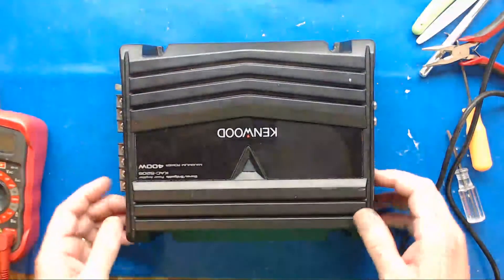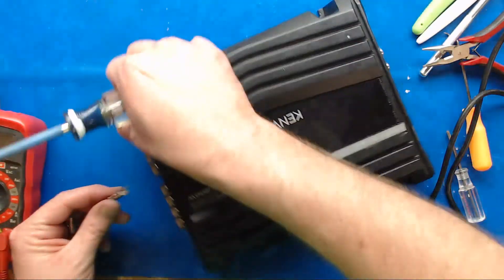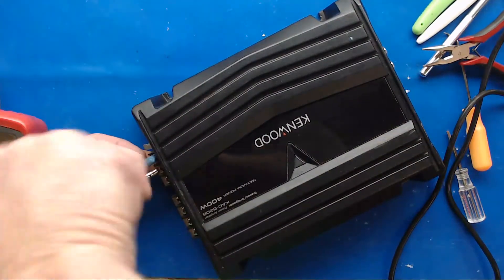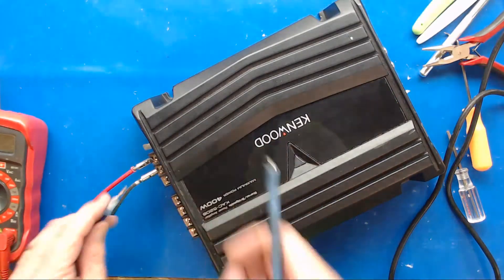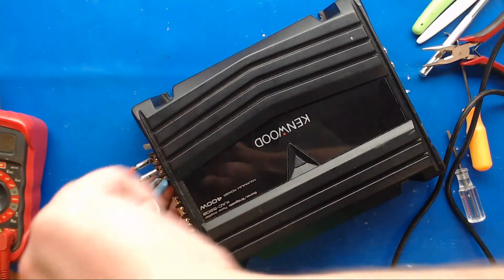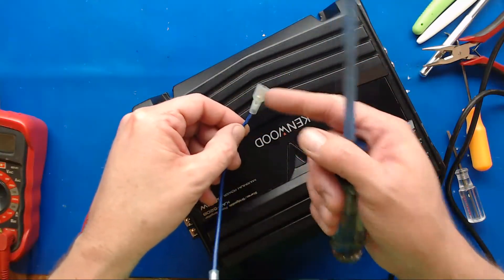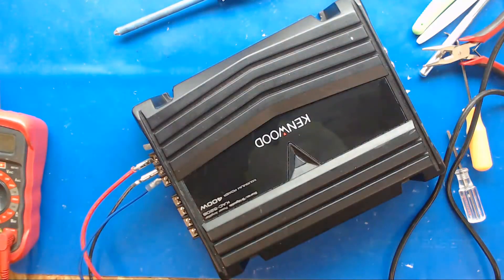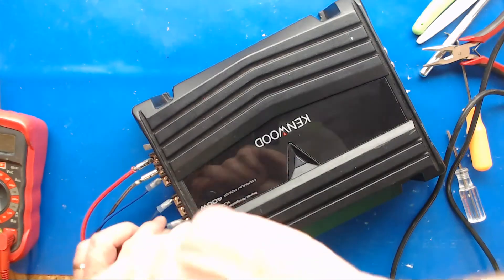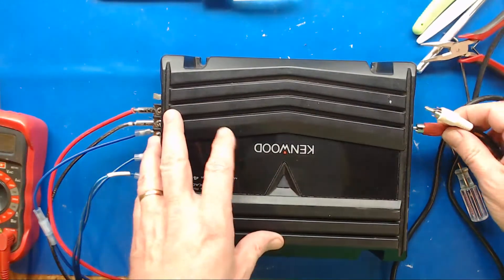So we're going to be upside down here because my power leads are over here and my RCA stuff's over here. We're going to hook up to the ground, power, remote turn-on. My remote turn-on's got a quick disconnect — I've got several different ones with different ends depending on what I need to hook to, like one that plugs into my end but then gives me a spade connector for Rockford Fosgate style amps. Slowly the more amps I work on, the more I'm getting my test setup to accommodate more and more things.